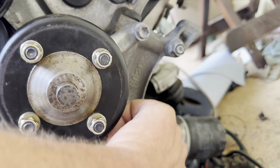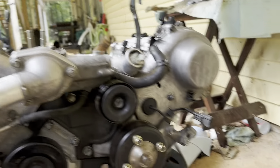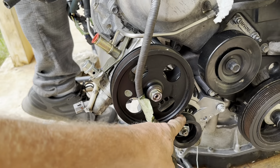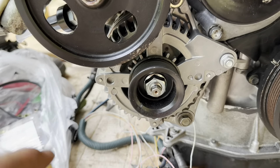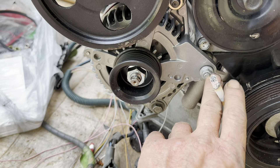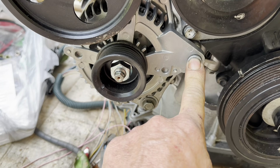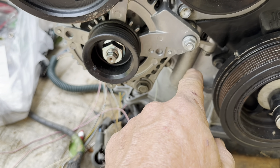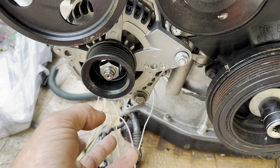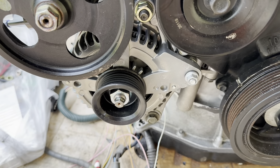We're waiting on the AC compressor, and then we'll be able to start putting belts and everything else on it. We want to put the AC compressor in before we put it into the car because it's in a very difficult spot to reach. We also wanted the power steering pump and the alternator in there before we put it in. Terry did wind up going with the oversized alternator — it's a 130 amp alternator off of an SC430. We added the extra stud and nut from Lexus to bolt it in. I'll include the part numbers in the description. The SC430 alternator bolts right in where the regular alternator bolted in — it's about 20 to 30 amps bigger.